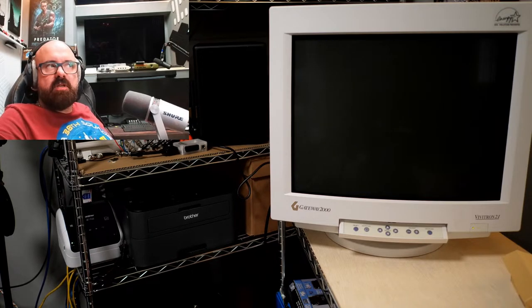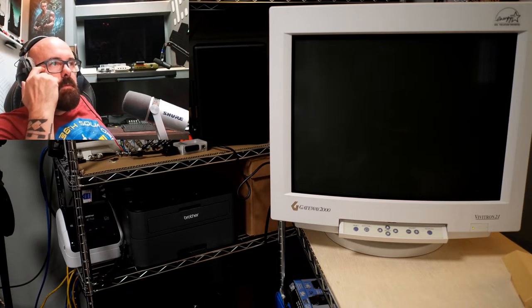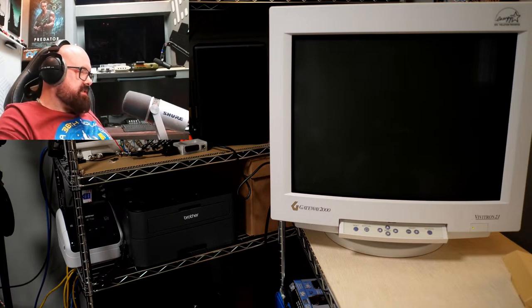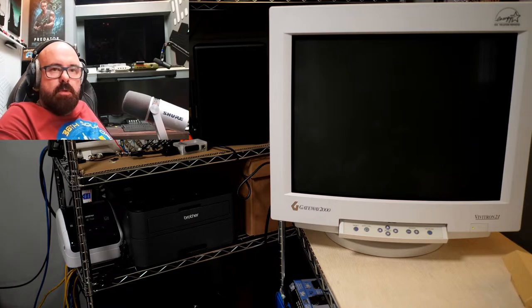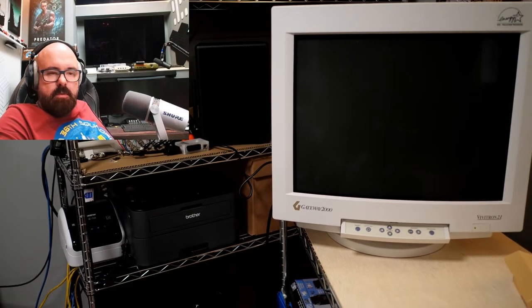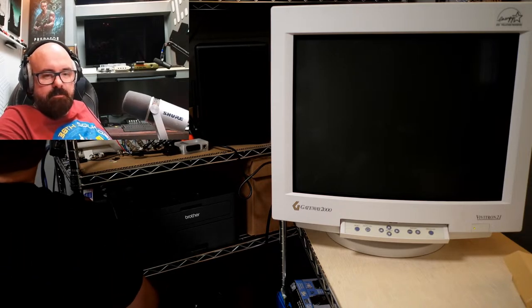We need to turn the server off and disconnect the cable. Yeah, and then I can go right from my capture card into the output of the onboard video. Make that easier. I'm thinking maybe we might need to disconnect the Cirrus Logic to get into the BIOS, and then change it to always be the primary as the old. All right, let me just get the display plugged in here and go from there. Yeah, MT83 is saying exactly the same. We should try without the PCIe card. Okay, definitely.